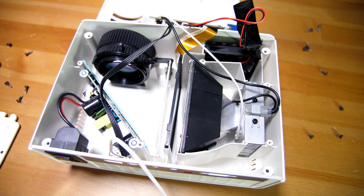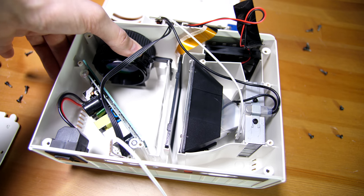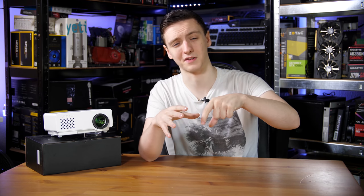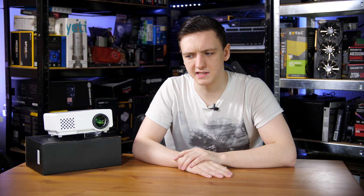I also removed the panel on top to reveal the LED and heat sink. It looks like a pretty tiny LED — probably a 5W or at most a 10W LED package — which is a bit strange given the fairly decent heat sink and very loud fan, as I can't see this getting all that hot. They do appear to have a temperature sensor on top of the heat sink, which is nice to see. There's also a fairly thin polarizer, and as you can see, the keystone mechanism just moves a piece of plastic to slightly change the width and angle of the image at the top and bottom — it functions, but it's not the best design.